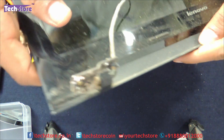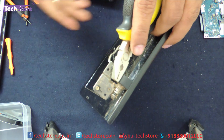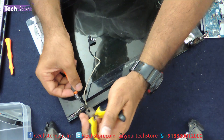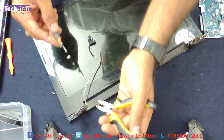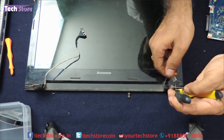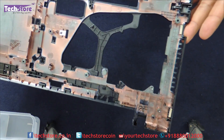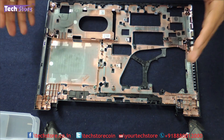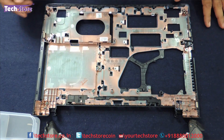So in a scenario where you have this kind of an issue where the hinge base screws have also come along, let's take a cutting plier and you have to remove the screws that are holding on. The screws will come off like this. Now let's take a new base — and very surprisingly, Lenovo has not used any different base or touchpad or any different products in the G series and the Z series. So both the G50 and the Z50 have the same base, touchpad, and basically most of the components are all the same.